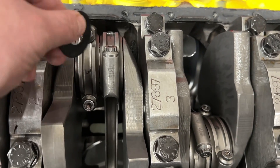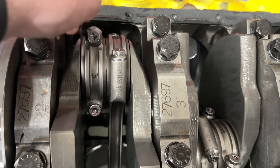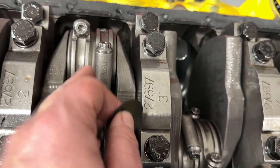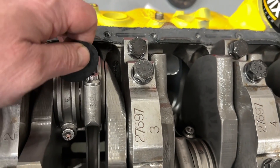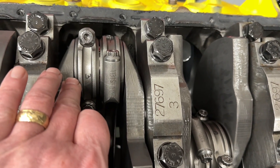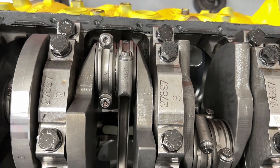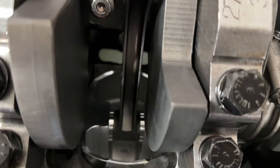Because if you look, this is a 30 thousandths shim — way more clearance, considerably more on both sides. Usually on an engine, you could push the two rods together all the way to one side and you should be about 30 to 35 thousandths. You're definitely not going to be 100. So that's like 70 and 70 thousandths on each side. You might say, 'How does that even work? That's not right.' That's because it's not guided from here, it's guided from there.